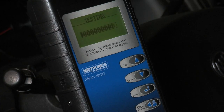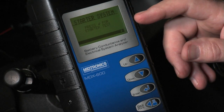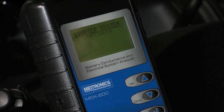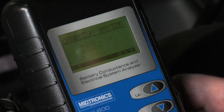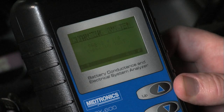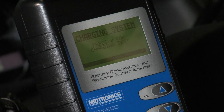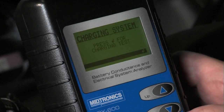The test is completed in less than six seconds. We get a good battery result — measured voltage 507 CCAs measured against the 525 rating. We hit enter to start the engine — that's the next prompt. For the cranking test, the answer is yes. On the starter we went down to 11.05 volts and the crank time was 1.24 seconds, from initial starter engagement until we saw a positive voltage.